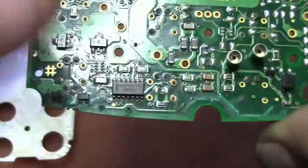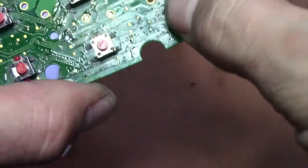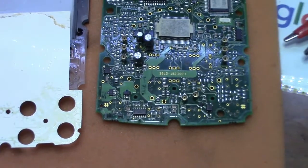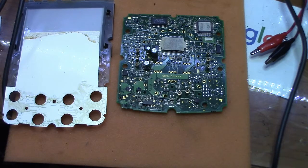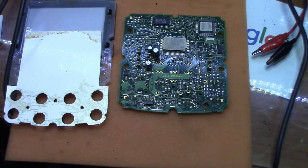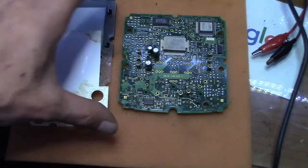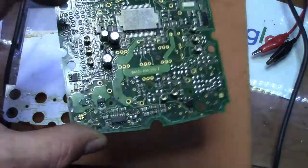I don't know how well you can see it on the camera, but there is a little bit of corrosion on the downside. The problem was that one of the switches is not working — I'll change all of them now that I have it in hand. In this situation the best thing is to clean everything well with alcohol. If you have water entering the instruments, just wash everything really well with distilled water, then use alcohol to displace the water underneath when you dry it.